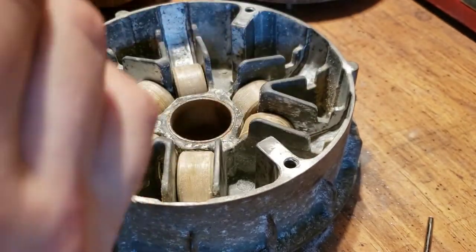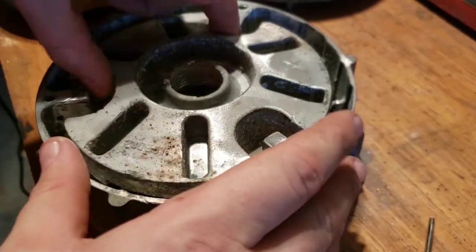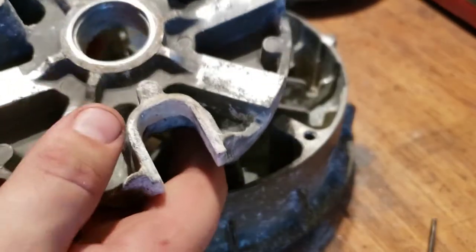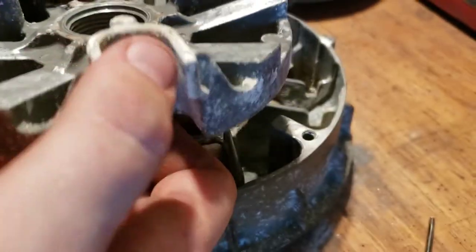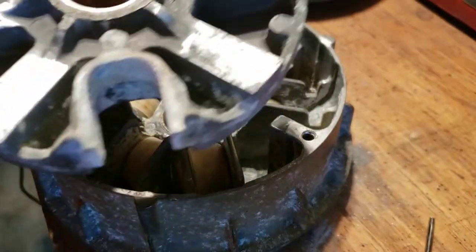And it is kind of difficult. It doesn't slide very well. It's a little bit stiff. See, it catches. And when I took one of them off, you can see there's quite a bit of buildup in there that's probably pushing it a little bit more closed than it would otherwise be. So I'm gonna clean these out as well, then put these pieces back on and reinstall everything.